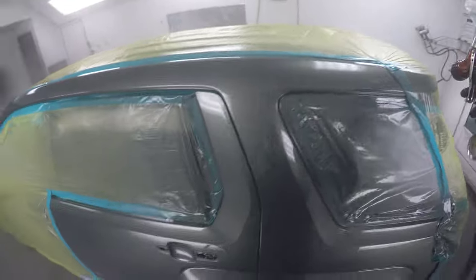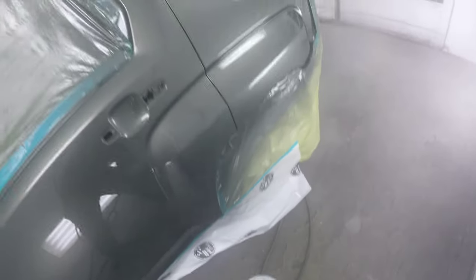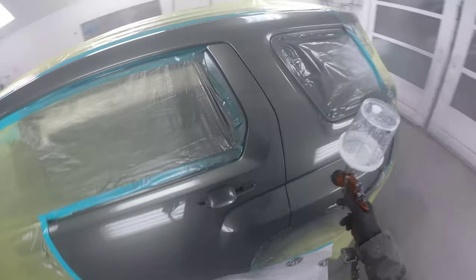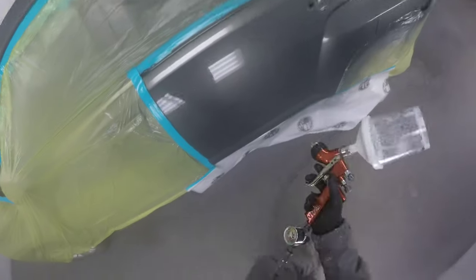You can go panel by panel, sort of like how I was doing it here, or you can walk the whole car like I did on the first coat — just doing every panel in one long stroke. I look over the panel, do a few touch-ups here and there where it looks a little dry or there's a little bit of dirt. I'll even try to put more clear on it to hide some of the dust and dirt nibs. And that is how I blend out metallics using waterborne paint. Like, comment, subscribe if you like the content.